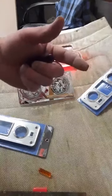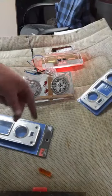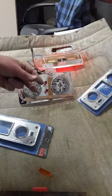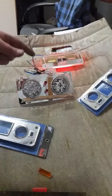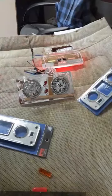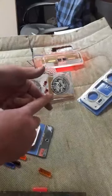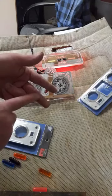For the door — I can add an extra wire that will go to your white, that is no problem. I'll do that for free to go to your door. You've got to let us know to go to your door sensor and it'll automatically turn on the white one when you open the door. We've done that for many people on the other styles. So if you want the extra wire just to go to your door sensor, that's not a problem. The rest of it is just power and negative — constant power and your ground. I can add a third wire just for your door switch so when you open the door it lights up.